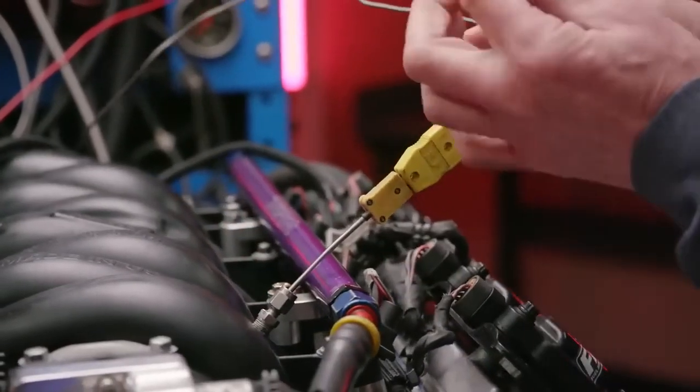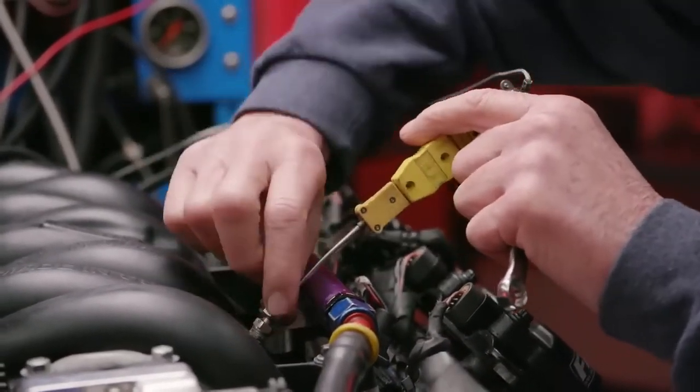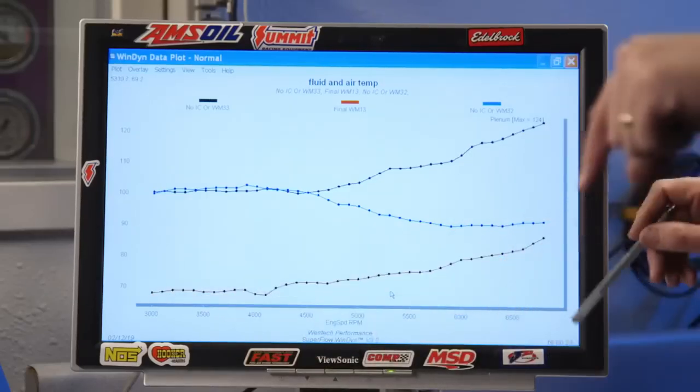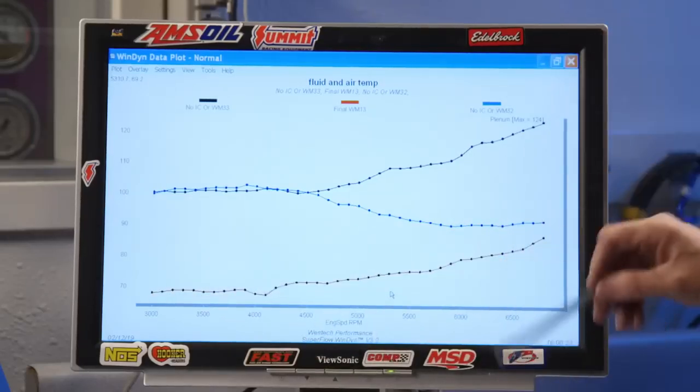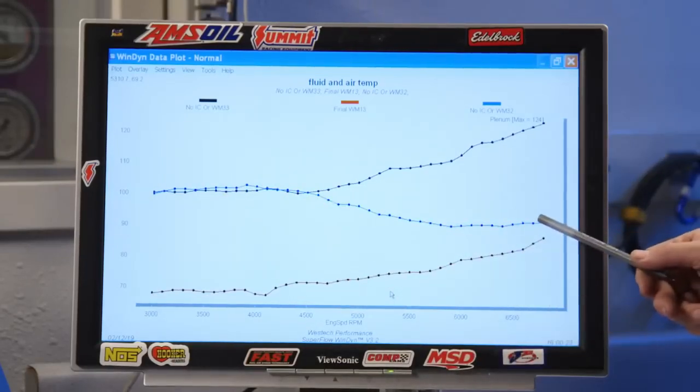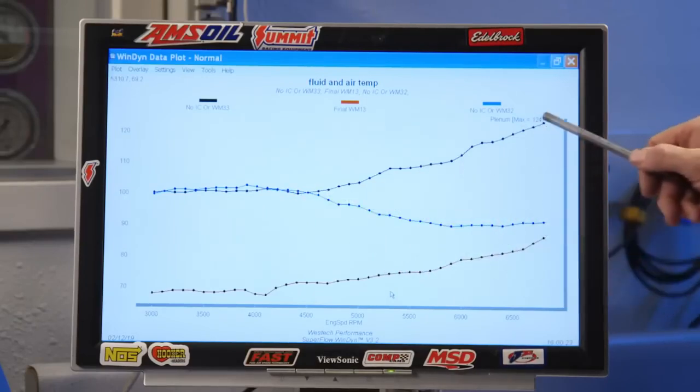And we found out essentially the problem here is that when you shoot water and meth through this intake manifold, the distribution is a disaster. Look at this. This is the water meth pull in the original location with the temperature sensor. Then we moved it and put this in number 7. All the way back. And this one in number 1.